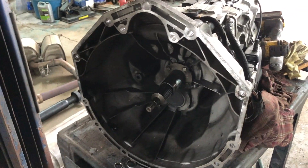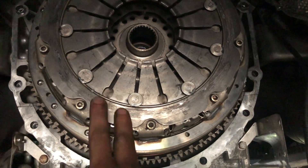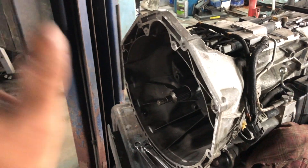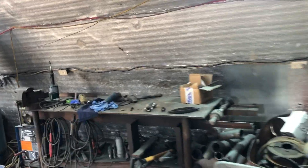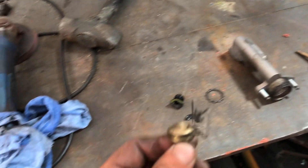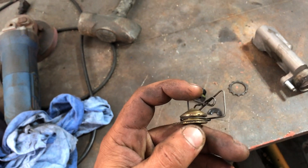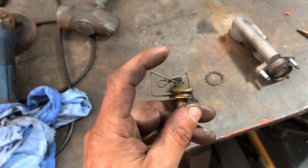The first time we had it out there were a lot of brass filings inside the transmission, which I originally thought was clutch dust. We do have a new clutch in it with only minor scrapes — I'm going to go with it for now since it has very minimal kilometers. But when I originally put this clutch in about 40,000 km ago, I bought a brass bushing thinking it would be better than plastic. Now that I've got it all apart on my carnage bench, this brass pin is worn — the nipple is supposed to extend out much further than it does.